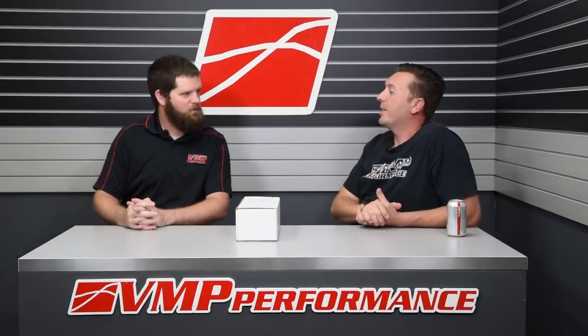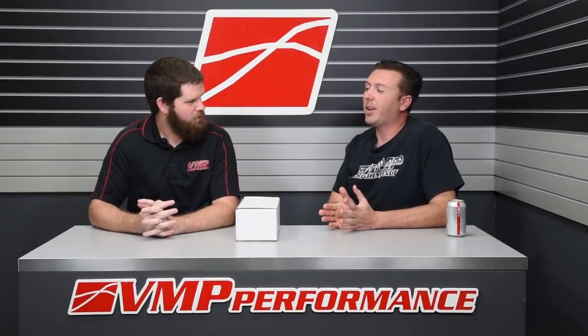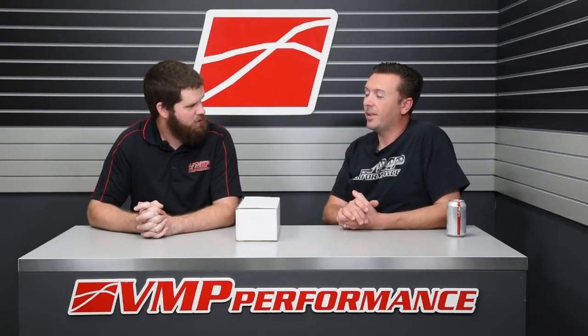So theoretically, we could answer this question without ever having to do it, if Ford mapped drive-by-wire accurately. We could look at the torque tables, but then you have to assume that the air charge or cylinder filling on the F-150 manifold gets you closer to MBT at lower engine speeds, because all the torque tables are mapped off of MBT, so your distance from MBT is going to change how much torque you're actually going to make. So if the F-150 manifold gets you better cylinder filling, but you're still octane limited, then you might be further away from MBT at those light throttle, light load situations.